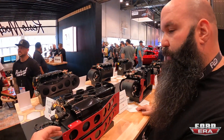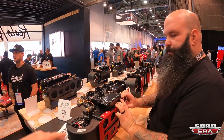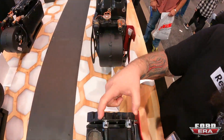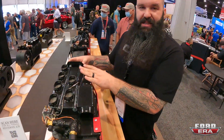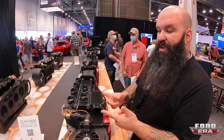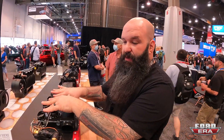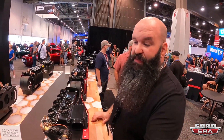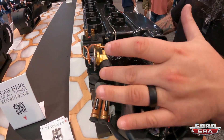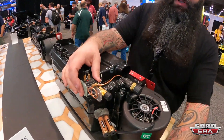This unit mounts on the firewall. You're going to have two servo wires because we have two blend doors, giving you infinite blend — floor to dash to defrost, whatever you want. On the back you have two designated floor ducts, two for your defrost, and four for your face vents. On the side of the unit you have your expansion valve, your suction line going to your compressor, and your liquid line — the smaller number six — going to your condenser. We also have a fixed thermostat and two heater hose connections.